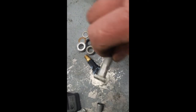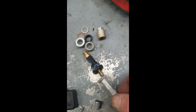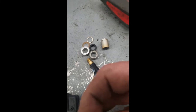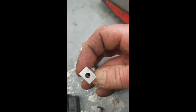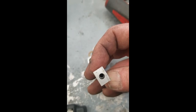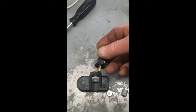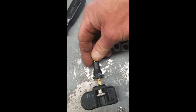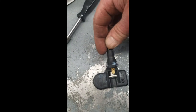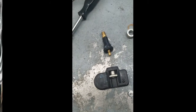The other thing I had to do is drill that hole out bigger — this hole was not big enough to pass through. I had to drill it first. After you cut the valve stem in half you'll find that it steps down inside to a smaller hole. I drilled first the exact outer hole size, going through the short piece, then one extra drill bit bigger for the inner step. Then this will pass through. When you put the valve stem in the wheel you have to do it first so you can get that stretch and pull it through like any other valve stem, then bolt the sensor back to the valve stem.